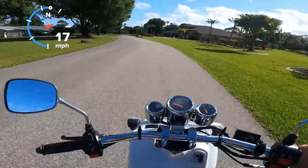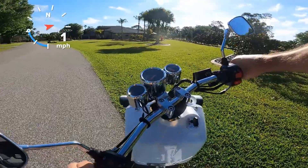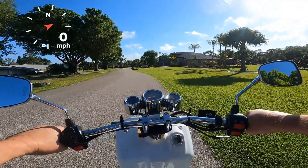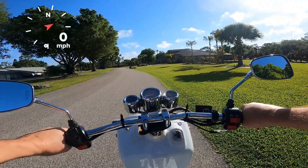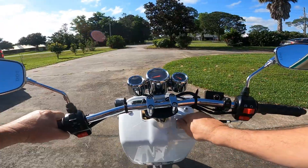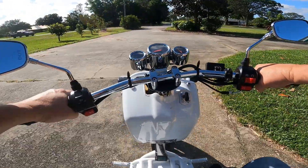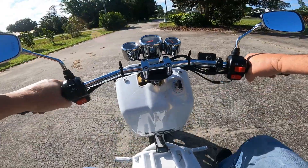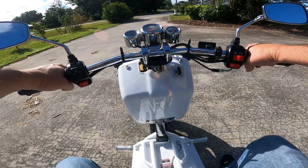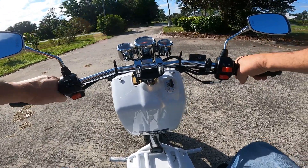Keep in mind, all this testing you're doing is just like tuning a carburetor — it applies to the rollers too. If you change something on the engine like a different cam or carburetor, you need to re-tune your carburetor and your rollers. The lighter 4-gram rollers actually made it faster because that power band is up around 8,500 RPM. Being able to run 9,200 RPM — more RPM is more speed. And with the heavier rollers, I just can't get to that RPM.